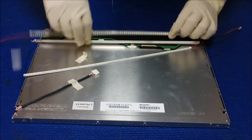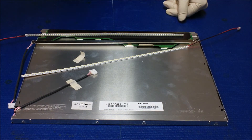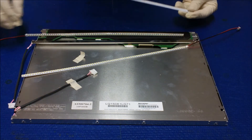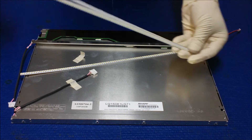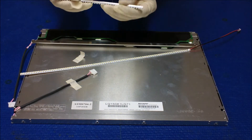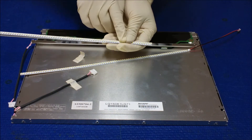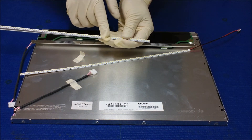In this case, I really want you to consider adding an additional heat sink, like this one. This heat sink is available on our site. What you do is just add it on the bottom of the LED strip and slide right back. That way there are actually two heat sinks now, besides the original one, so it spreads the heat much faster and the LED will last much longer.